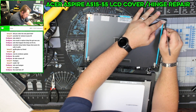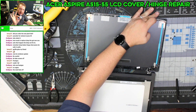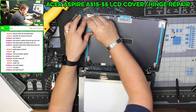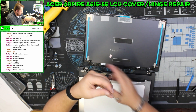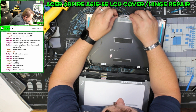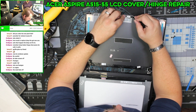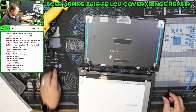Now I'm going to take my little metal tool — or you could use a separator like this — and just flatten this out as much as possible so it re-adheres. Next thing we're going to install is the video camera. There's only one place it can go; it's got little pins to hold it in place. Make sure this cable up here stays out of the way.